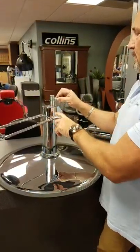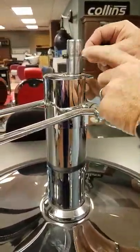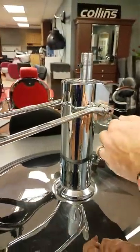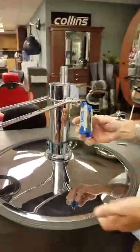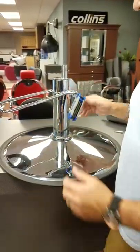If you do, take a quarter-inch bolt — this is also demonstrated in one of our other videos — and just take a hammer and drive this roll pin out if you need to reuse it. To take the treadle off, it's a 4mm Allen wrench to remove it. Remove the two set screws and the treadle will come out just like we did on the K base.